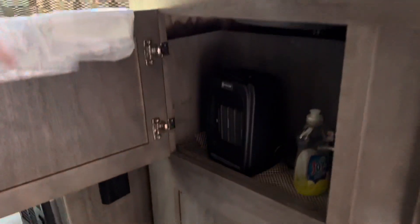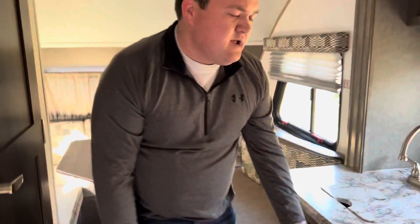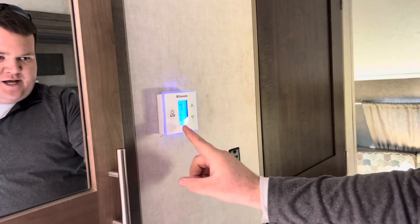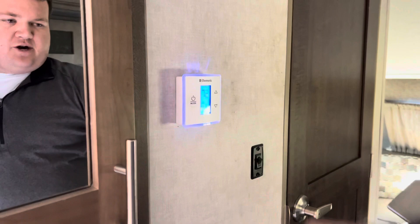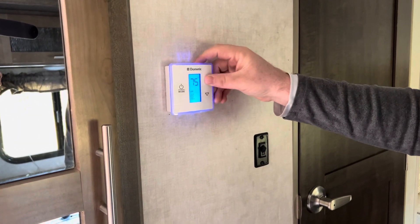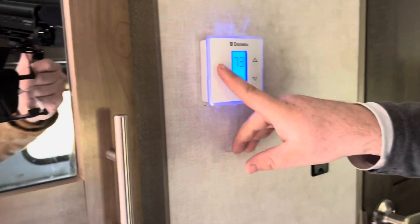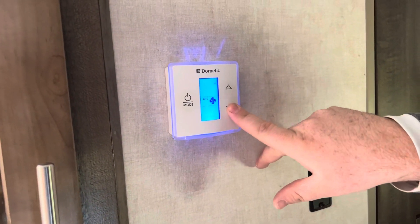Right in here we also have a small space heater for when it gets cold in the camper. Or if you're not connected to electric, come to this thermostat and press this button a few times until you get to furnace, then turn your temperature up and the furnace will kick on. Once it begins to run, it'll take a little bit to actually heat up the camper. If the fan is running, press this button twice and turn it to auto, and your fan should kick off.